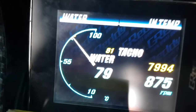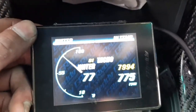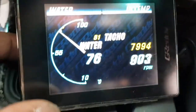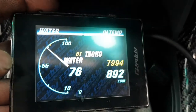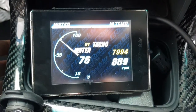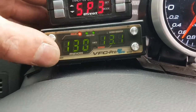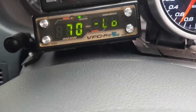I've got all the way up to 81 degrees. Come on, cool back down. 73 is where I want to see it because that's where I've seen it since the rebuild. It's cool this Greedy iTouch — you can change all your settings on it, there's heaps in there but we'll go over that in another video. 76 — I want to see it at about 74 before I'll turn the engine off. After one quick drive to test this, see I don't know how to get this thing going, but all the wires are hooked up to it now — there's no reason why it shouldn't be going.